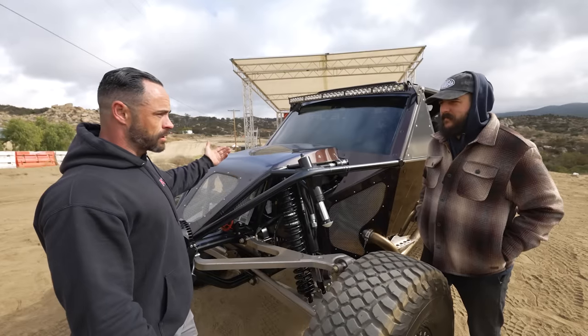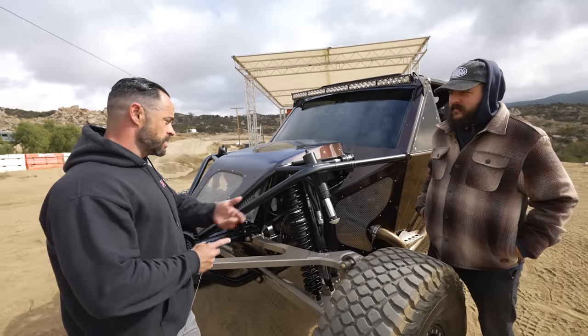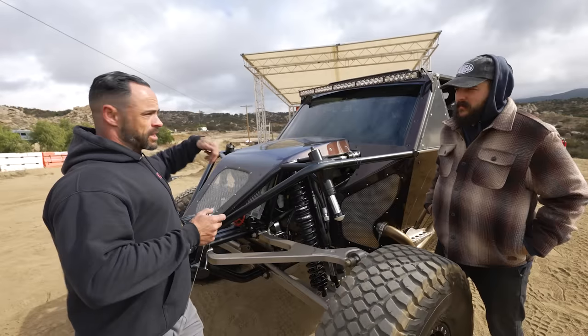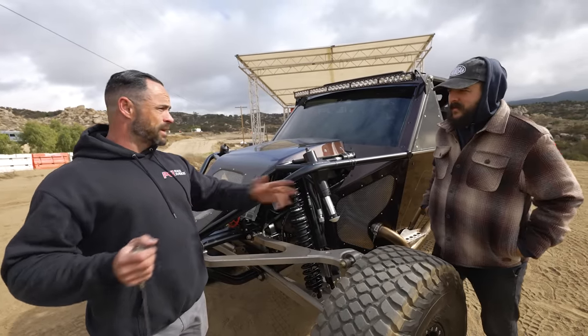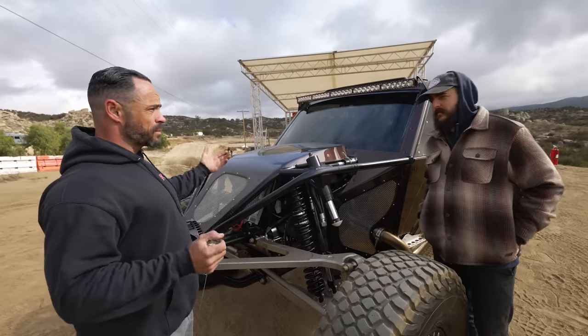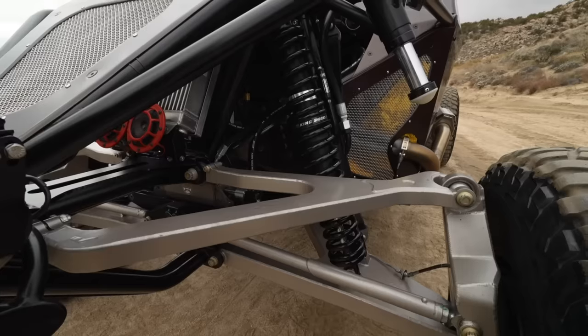When you're going through the whole car, the shocks are already gonna get rebuilt. When they tune shocks properly, they take all their measurements, they corner scale the car, and then they do internal valving on the bench before it goes out in the desert. So when that stuff's already apart, it makes sense just to coat everything and have it all consistent. Get it all powder coated. Yeah. And then the giant beefy arms as well to go with that.